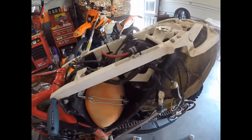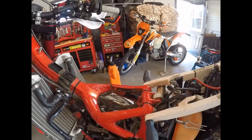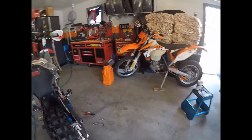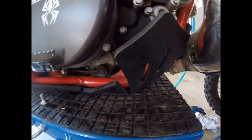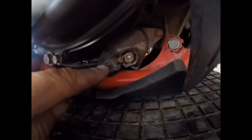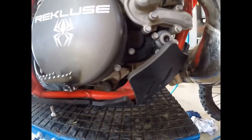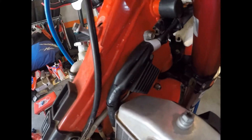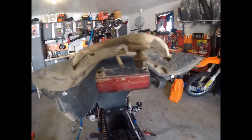I'm in the process of tracing wires down to the stator and also to the ground on the other side. I'm hoping that the ground on this side might be the culprit — right down here. I'm hoping I just need to take that off and clean it, and that'll solve the problem. If not, we'll have to go to plan B: check the stator or the rectifier. But I think those should be fine — the bike's got relatively low hours and the previous owner took very good care of it. This is just stuff letting go over the course of three years.